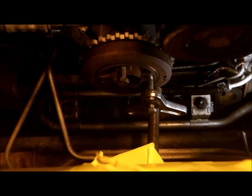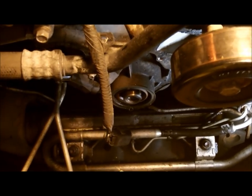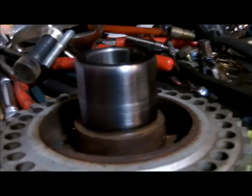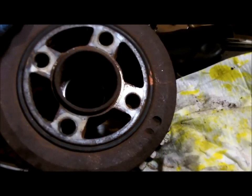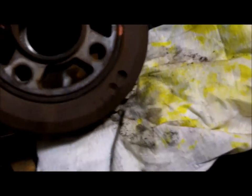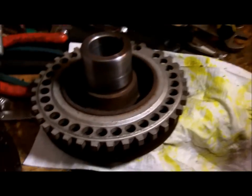Slow and steady on this — you don't want to break anything. Well, it took a little while, but as you can see the crankshaft pulley is off. I've cleaned it up already, and you see a slight groove in there, but they got a fix for that. You don't have to buy a new one as long as your rubber is clean, and if you can see timing marks between the inner and outer parts of the harmonic balancer and they're lined up, then you're okay. If not, now would be a great time to replace it if that rubber was dry rotted or cracked.